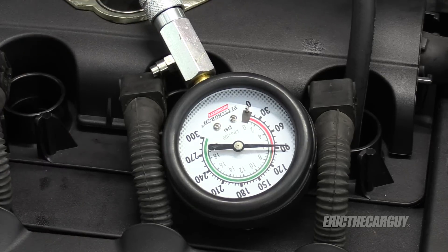Hopefully I only have to get a couple of valves, but the cylinder head's coming off. When I initially saw the first result of 90 PSI, I thought that was low compression — I like to see things up in the hundreds. But the fact that the other three cylinders that were operating all came out at about the same 90 PSI, I can reasonably conclude that those cylinders are okay. If there's a large variance between cylinders, then that's worth investigation. But if they're the same pretty much across the board, you can be reasonably sure that that engine is in good enough shape to run.